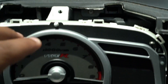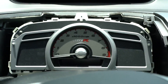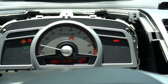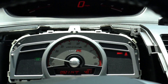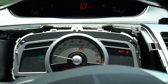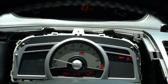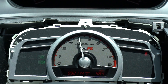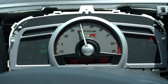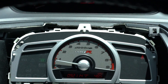I just installed the tach but haven't put the plastic back yet — I want to make sure everything is working first, and it seems like it is. I'm also going to drive it to make sure the RPMs are matching what they were before. Third gear is usually almost a one-to-one on the tach and it looks good, so I'm going to go ahead and reassemble the whole thing.